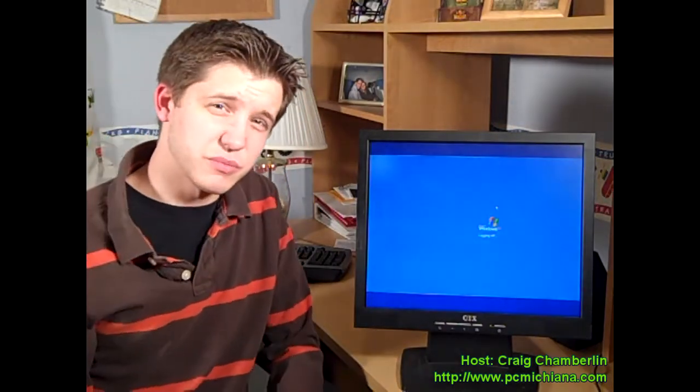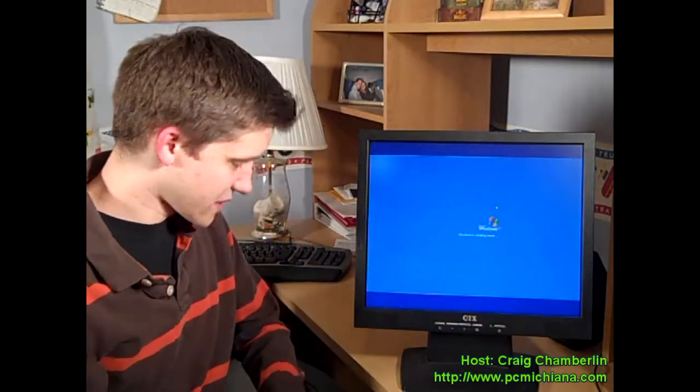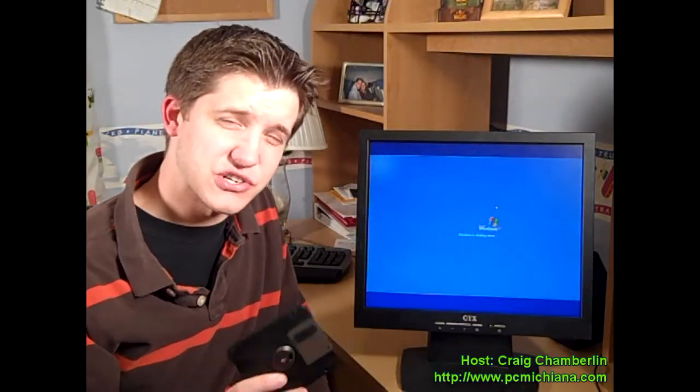What this is going to do is restart the computer. Since we set up our BIOS to boot off the CD-ROM first — and make sure your floppy drive isn't in — it's going to boot off that CD-ROM. We're going to leave the boot manager as a fallback just in case the installation doesn't go smoothly.